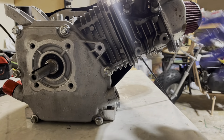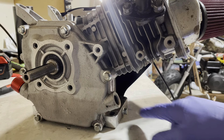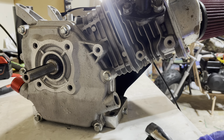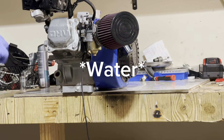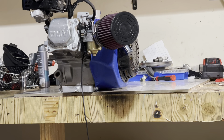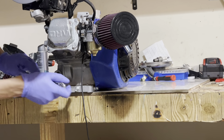The first thing you're going to want to do is remove the oil drain plug. It is a 10mm bolt, so grab yourself a ratchet and a 10mm and we'll get right into doing an oil change. This engine has been sitting outside in the rain, so we're going to see if any water got inside the engine. It's loosening right here.